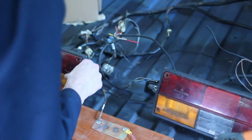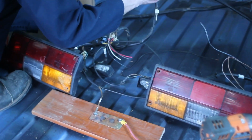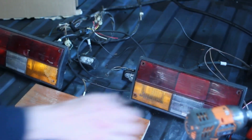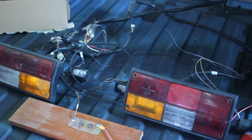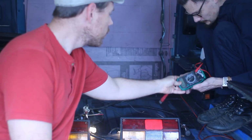No, seriously, we're gonna go around and take a look. At the end of tearing the wire loom apart last week, it was late and we said, hey, let's hook everything up and see if it works. And we just kind of halfway hooked a bunch of wires and only half the stuff worked. So we're actually properly making sure we've got all our grounds connected, making sure all our connections are good, and we're going to try round 2 on that. Which one's continuity? This one? Yep.